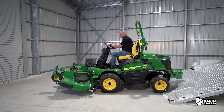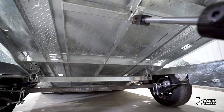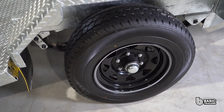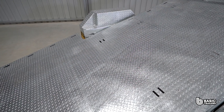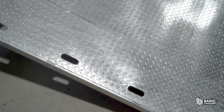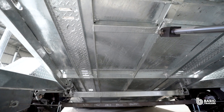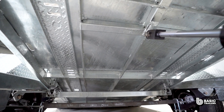Let's talk a bit about the running gear on this trailer. It has 50mm solid axles, 9-leaf off-road eye-to-eye springs, 12-inch disc brakes and 15-inch light truck tyres. This is all standard and can be upgraded if required. We only use Australian Steel for all our trailer chassis and bodies. The outer chassis on this trailer is fabricated from 75 x 50 x 3mm RHS and reinforced with 50 x 50 x 2.5mm SHS cross bracing around 350mm apart.